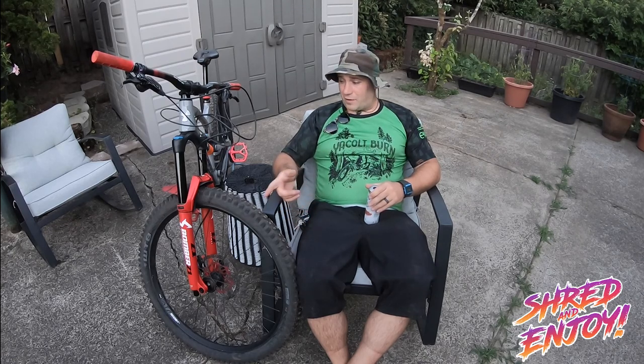They worked at Ski Bowl — everyone was really surprised how much air vented out of the forks. A Fox 38 on one of our friend's bikes let out a significant psh-psh-psh — there was a decent amount of air in there. From dirt biking and from burping forks with little zip ties to sneak in and let the air out, it makes a huge difference with small bump compliance. I'm sure more manufacturers will be getting on this because the difference is staggering.